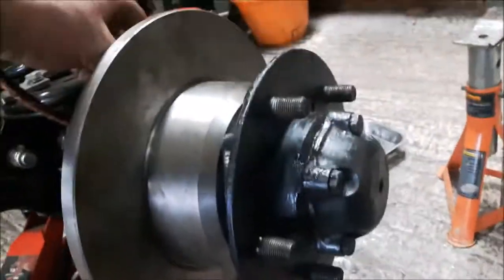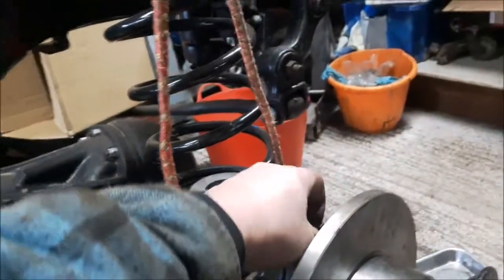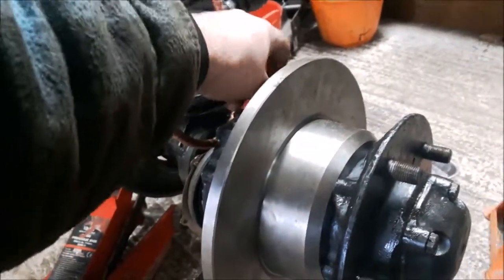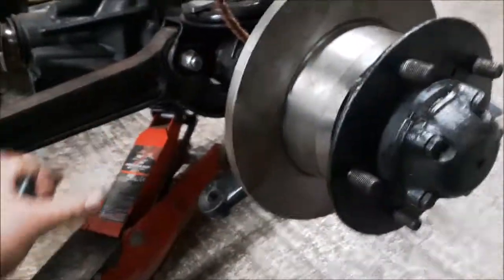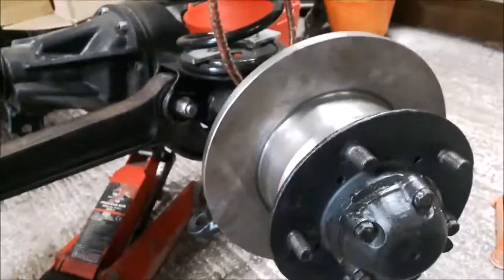The next thing is I still need to put the brake back plate on, secure the sweep ring, top up the axle, and secure the track rod arm. The caliper goes on later. But that side is done. So that's pretty much how you do the swivel preload — start with something that gives you a bit of drag and take it from there. If it's using too much force to pull the wheel around, add shims. If it's too little force, reduce shims. It just compresses the bearings together.